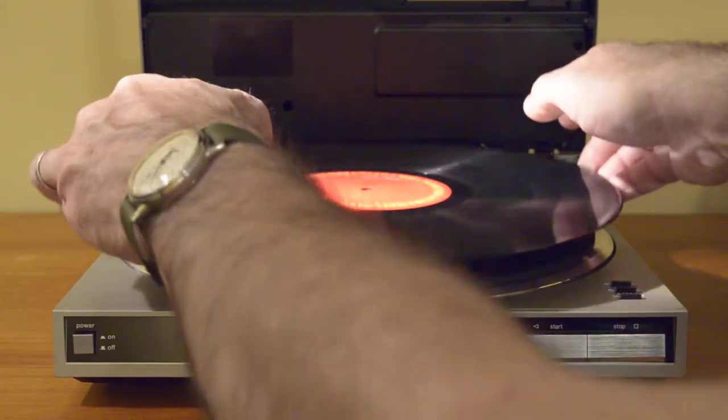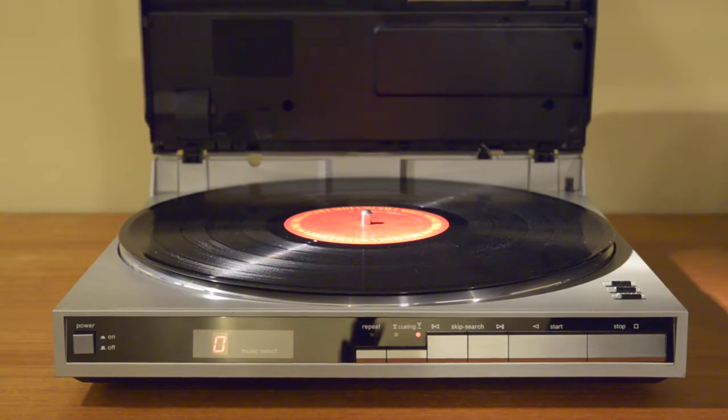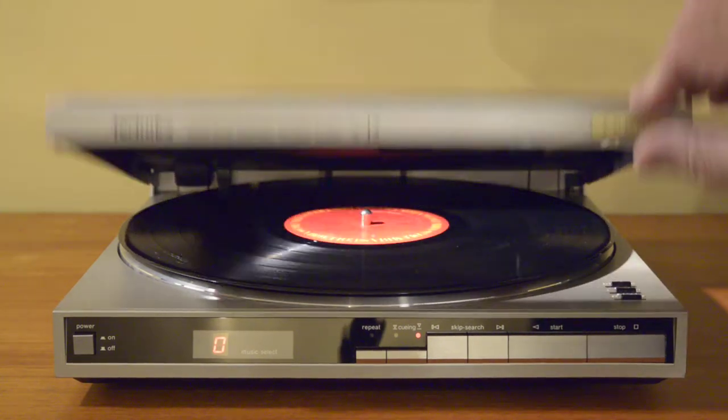You can see the record really fills up almost the whole thing — there's just enough space around it for the clamshell top to come down. I did put a new cartridge on this: the AT85EP, a very good elliptical P-mount cartridge made by Audio-Technica — a nice upgrade for this table. Most of them come with old worn-out or bent P-mounts. Just a note: this will be shipped very well. You do need to protect the stylus, either by removing it or covering it, and the platter should be removed — it's removable just like a normal turntable.